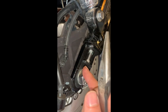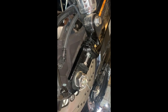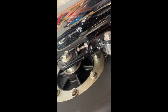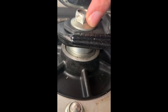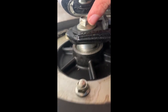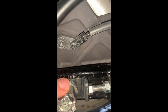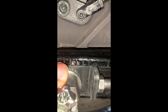Hold the top while you do this so it doesn't flail around, and do the same with the other side. Checked everything — everything's snug. Check them again. Making sure my hash marks are right. Here's dead on — a little under halfway on the third mark. Same on this side, a little under halfway there. I'm going to double check the chain.